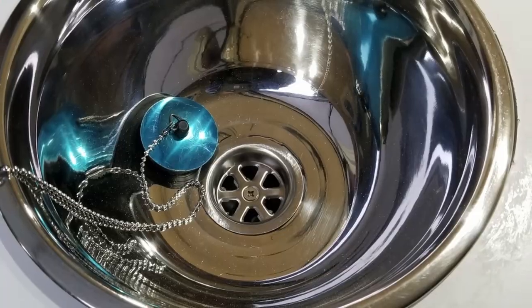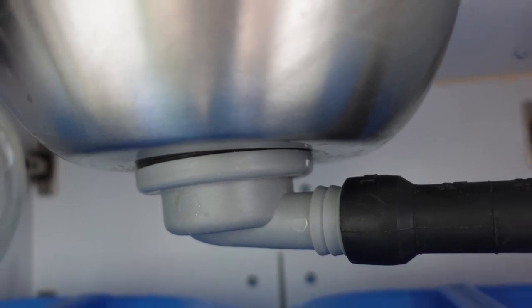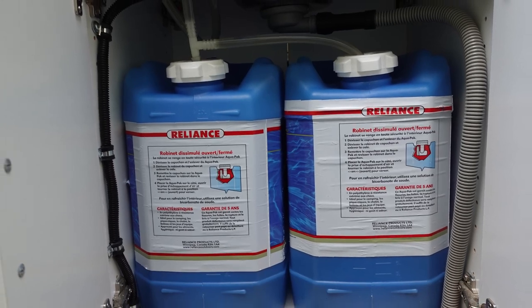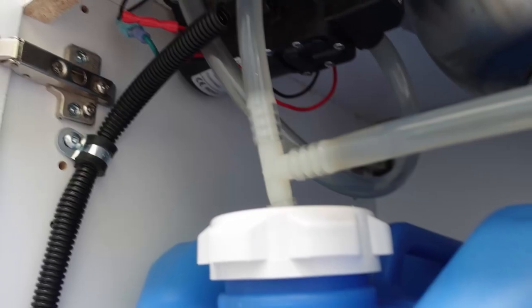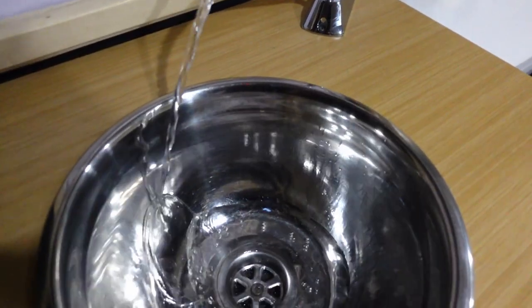The second thing was finishing up the water system, which was pretty easy. All I had to do was install the sink in the countertop with a used elbow drain that's used for a boat, to run the hose down to the bottom of the van which drains the sink out to the road. The water tanks I was able to just slide into place because I had already measured to make sure they were going to fit perfectly. It was just as simple as cutting some water tubing to link to the water pump that would make the faucet pull from those tanks.